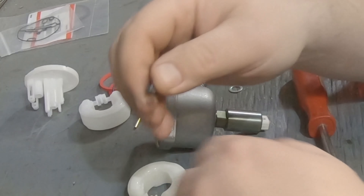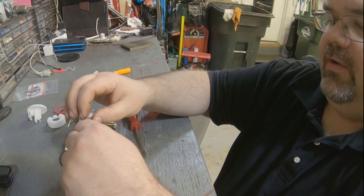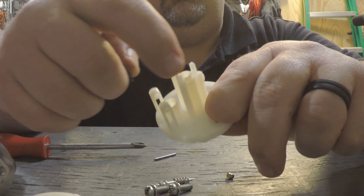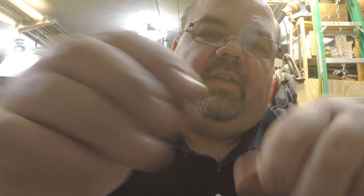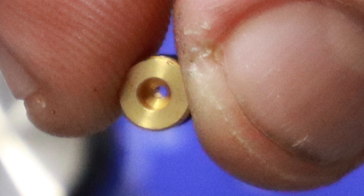This tip isn't something I've seen come off in another carburetor unless it was so gummed up that it pulled off when you removed it. You're going to reuse this. Some kits include this piece too, but if you're reusing it just make sure the hole is cleaned out. If you are reusing your jet, I recommend replacing the o-ring — but if the jet looks fine, you can reuse it. Make sure the hole through the center is clear; hold it up to the light and look through it.